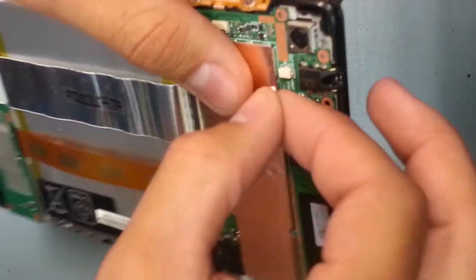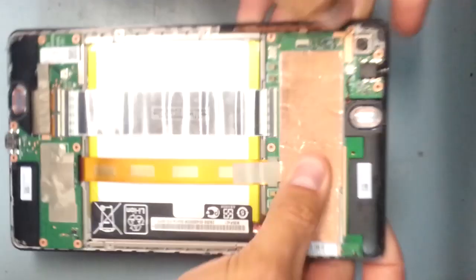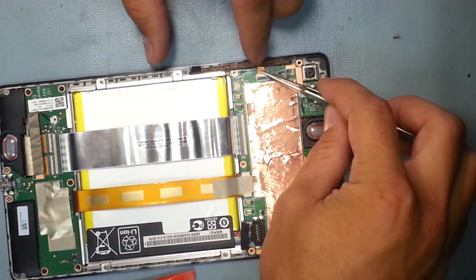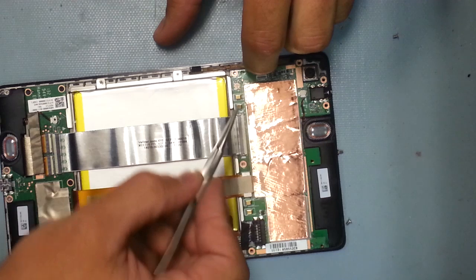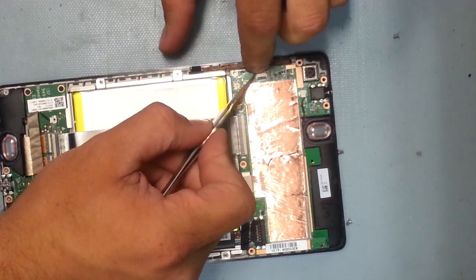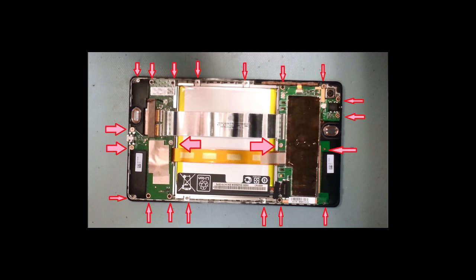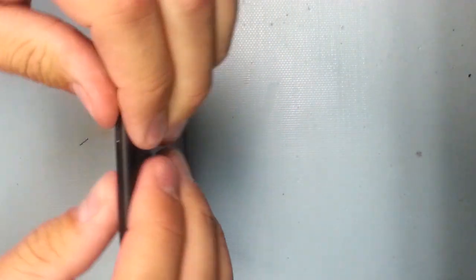Here's a better angle of the speaker wire being plugged in. Two little notches go up at the top and it slides into the little hole. Then here's the ribbon cable for the power and volume buttons — just wiggle that into place. Here's the screw layout again. The better you kept the screws organized, the easier it will be to screw everything back. There are 21 screws total. Once all the screws are in, pop the back housing on starting with the charging port end first, then clip up and around the rest of it.